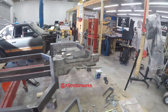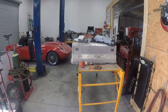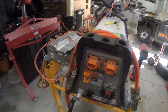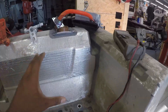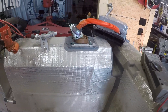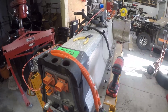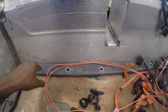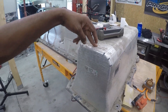Back to the battery pack — I'm going to show you a quick clip where I start tearing this pack down. We want to make sure our cells still have voltage; that's the main thing we want to accomplish. When we measured at the terminals we didn't get anything, but we have a strong feeling that the BMS — the internal battery management system — deactivates all power to the cells and hopefully preserves them. We believe it kicks in at a 10% threshold, and we're hoping that saved the cells. There's a bunch of bolts around the perimeter of the battery, all 10 millimeter, that we're going to loosen, and then the entire cover is going to come off to expose the batteries.